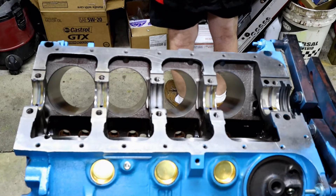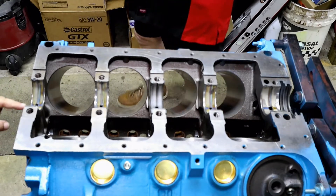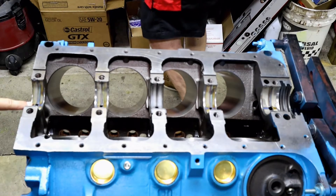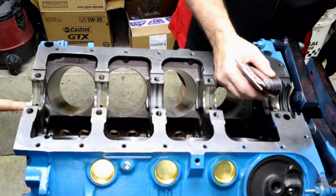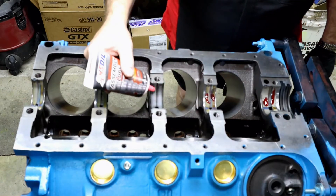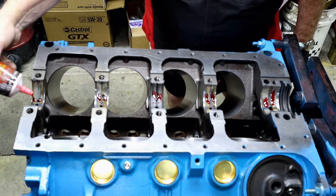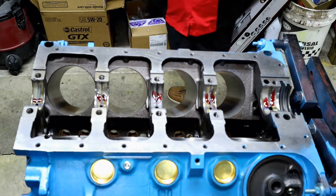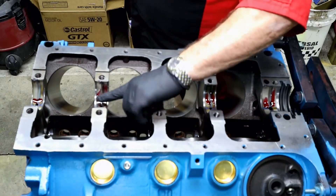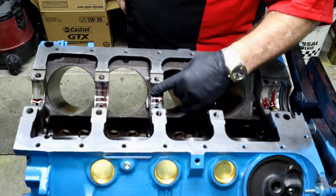We're going to go through that process here because we are dealing with a brand new crank. Some eagle-eyed viewers might say, hey, on your other build these were all shiny — they had a nice sheen to it. However, these don't. Well, these are high horsepower bearings, so these have been additionally treated to handle those higher revolutions. That's why they don't look as shiny and pristine, but there is nothing wrong with this. They are not worn. Those marks are from the heating and treatment process for additional hardening for use as a race bearing.